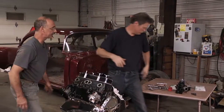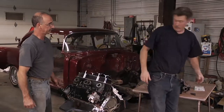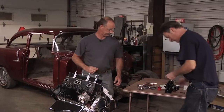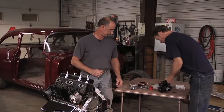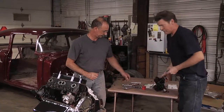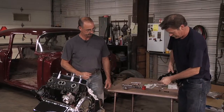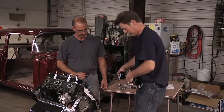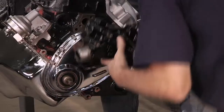Water pump. All right, and that's a pretty darn easy one. Four bolts, two gaskets, one water pump. Now sometimes there's things that get attached to water pumps on these bolts — in this particular case there is not. So we're just going to put that in.